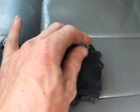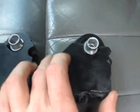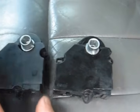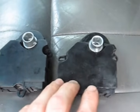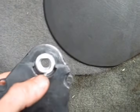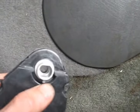Now, you can't really move the actuator, you might break it, so you're going to have to move the shaft of the vent flap to get it close and then pop it in. But other than that, this pretty much just bolts right in with no trouble. The new actuator comes preset to the center of its range, so I just reach up there. I don't know if you can see that. I need a better light.